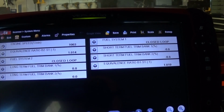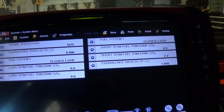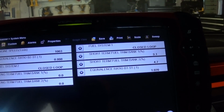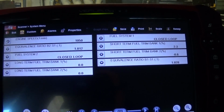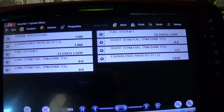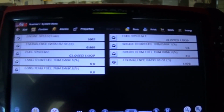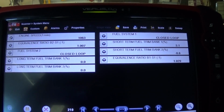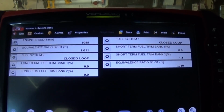So we could see, at the time I was completely confused. When I started the car the first time, I didn't film that part. The battery was disconnected, and the fuel trim was positive 25%, and once the engine warmed up it got a little bit better, and I mentioned that in my part 1. Honestly, I don't even know if cleaning the mass airflow sensor and the air filter made that much of a difference anyway. Maybe I was fooling myself.